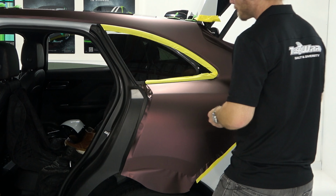It's basically an air bubble in here for me to do this, okay? And between the doors, obviously it's going to get a little choppy, so we take our time. Make sure you follow the groove, because there's a space there. Let's keep going. We can go right into the rear quarter window, but I'm going to stop a little bit in, and then from here I'll take this up, because I haven't done the rear quarter window yet. We always separate our areas.